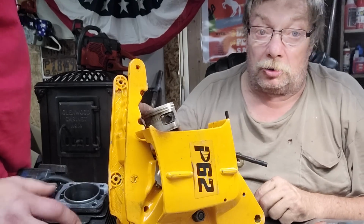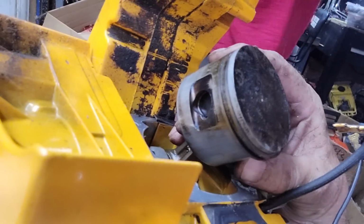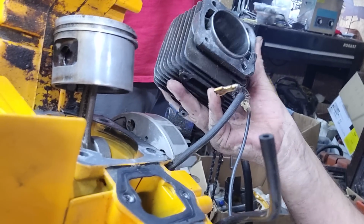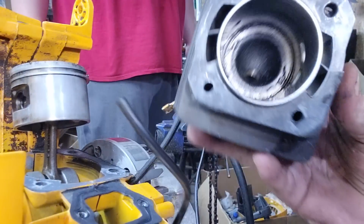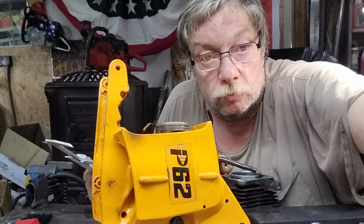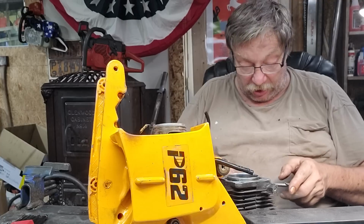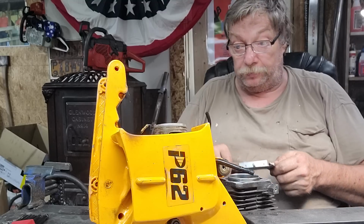Well, that's a short barreled cuss. I'm going to show you. That's a short barrel thing. Boy, that's big. Let's see that cylinder. It does not have boost ports. It does not. Okay, I'm going to set you down and we're going to take some measurements. Interesting. They rated these SAE, 57 millimeter for going on a metric scale.